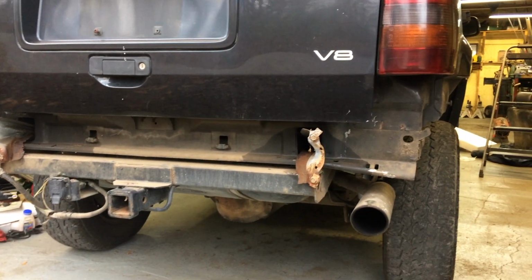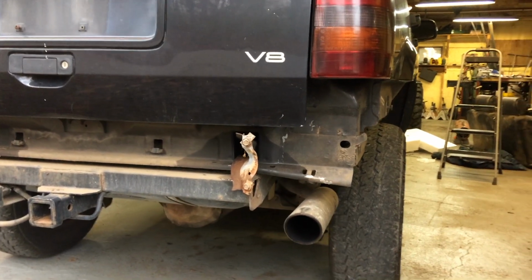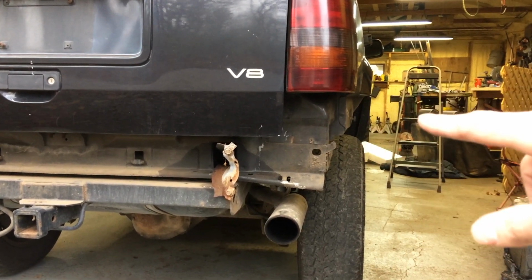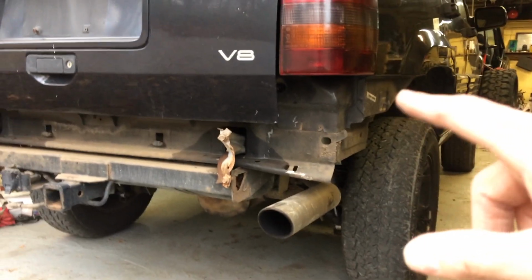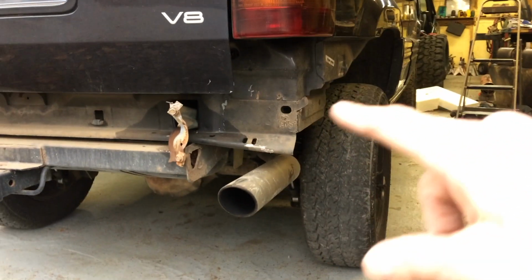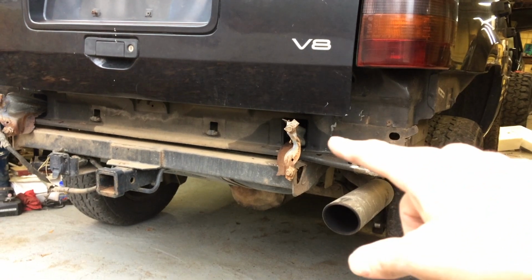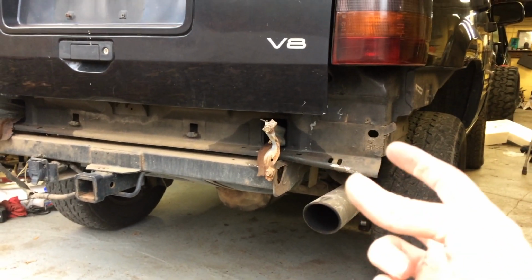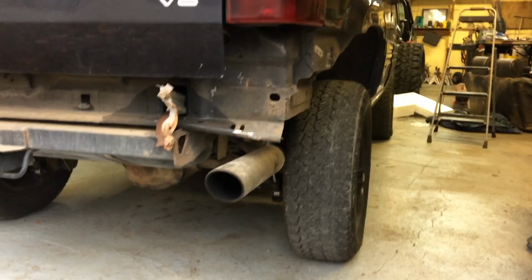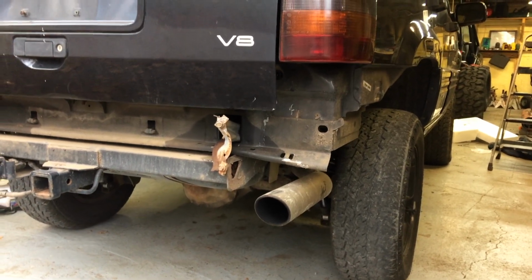Now for the back bumper, it's the same thing as the front. It's really complicated because you have to come across and then go up and then go around. It's kind of the same thing on the Cherokee, but not quite as much of a height difference right there, if at all. I don't think there is any. But instead of putting the stock bumper on the back here, I really want to try to figure out something different. So I think what I'm going to do is cut some of this stuff off here. The hardest part on these bumpers is figuring out how to tie them into the unibody. It's going to have to go in that hole somewhere, and there are some bolts that come up through. But it just makes it so much more difficult on these unibodies to figure out how to tie into the frame when there really is no frame. So I'll save that for the next video.